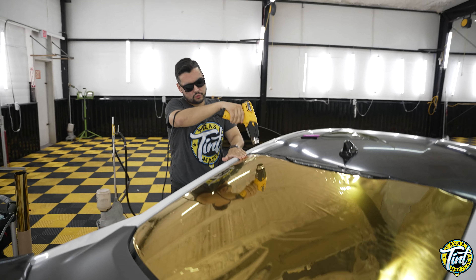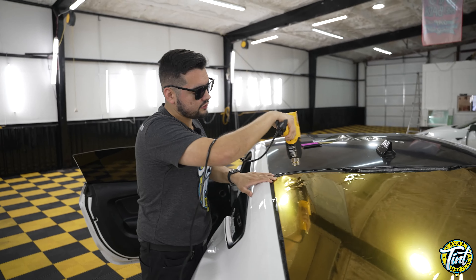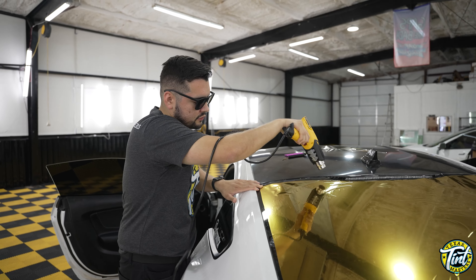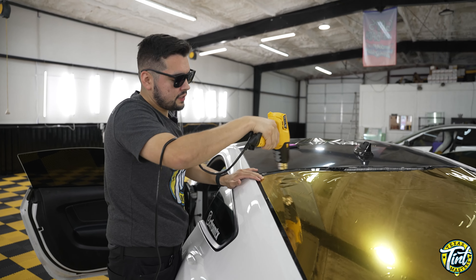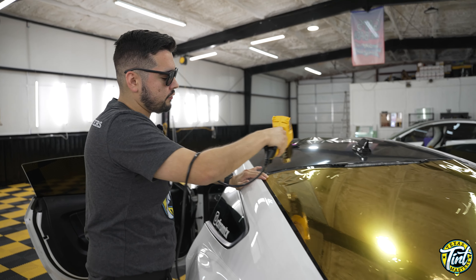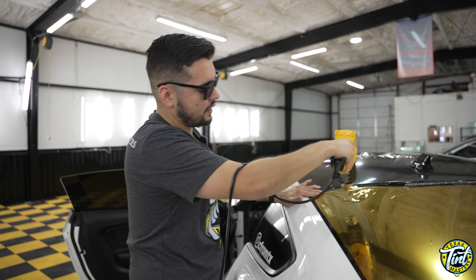I'm pocket shrinking these little corners right here because I don't want to shrink the finger and potentially cause ghosting. Ghosting is a term usually referenced to a metalized film having its metallic particles broken down due to heat, which usually happens when you overheat it during the shrinking process. I'm being very careful not to add too much heat to one specific area.